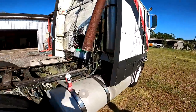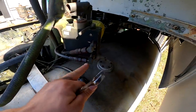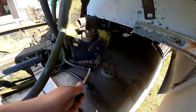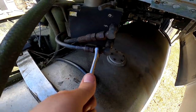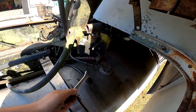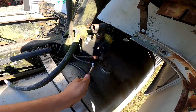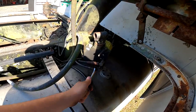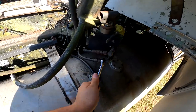In the first video I went to start this — the hose — actually I don't think it's in the hose, Chris, I think it's the fitting that's just bad. What we're gonna try to do is switch these fitting hoses around to see if we can make it jack the cab up without having to change the whole hose out. This fitting is just trash.